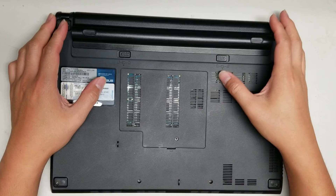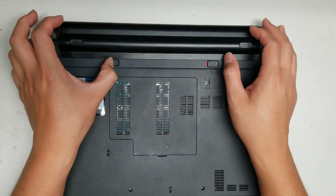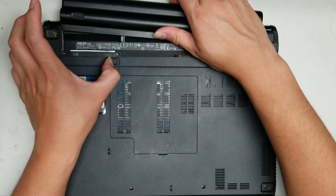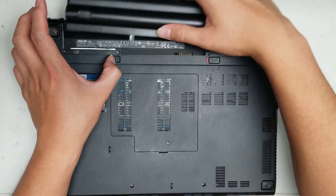First, what you want to do is remove the battery. Pull these two clips — or tabs — to the side, and then you can pull the battery back. When it goes in, it goes at a kind of a weird slight angle, so just know that.